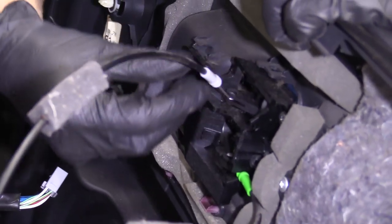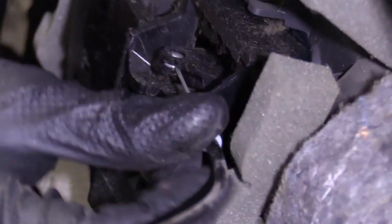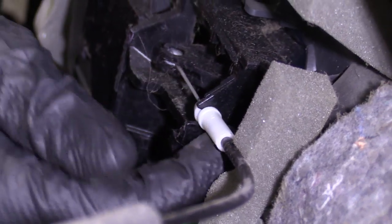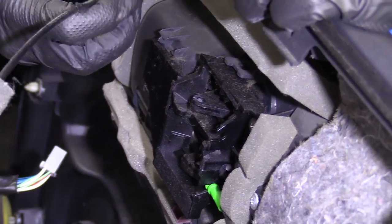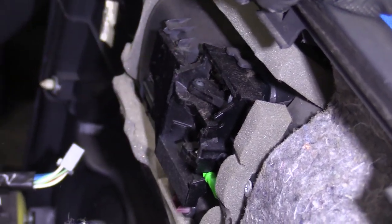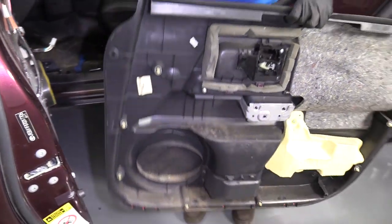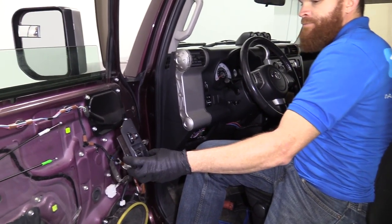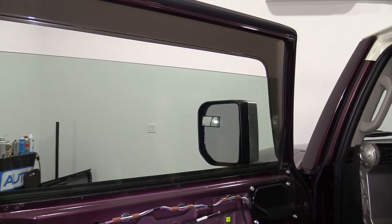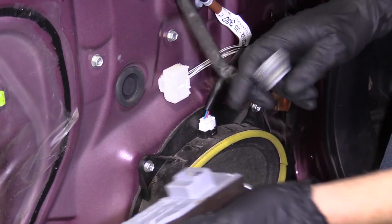Behind here we have our cables. This one's the door lock up along the top. All you do is take the white — pry it away, then lift right up through there. There's a little slot; it just goes through like that. Then I'm going to take the green one and do the same thing. Now we've removed our left front door panel. Let's plug this back in, put the key in the on position and put up the window. Now we can re-disconnect this and set it aside.